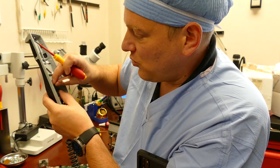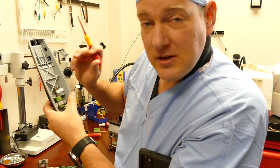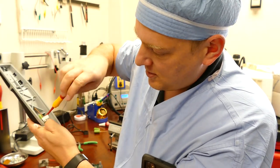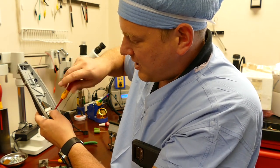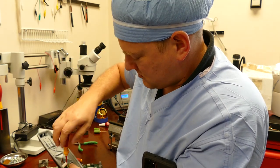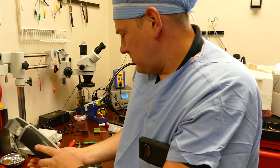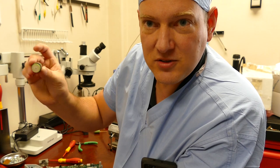On the other side of the capacitor there's one wire that's going to be soldered that runs to the large connector — and that is it, that's the first step. Second step: take your T10 and loosen up the screws holding the hold-down strap on your capacitor. Set that off to the side. And here you can see the capacitor just popped right off.